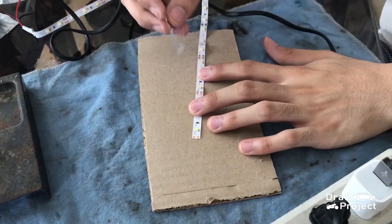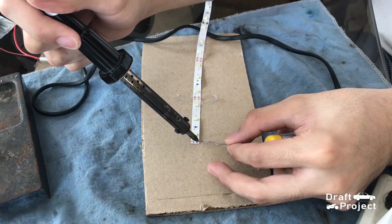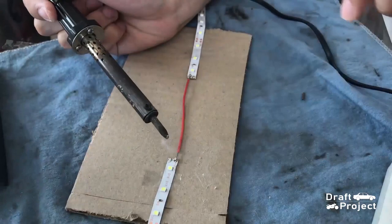The wires are routed in this section. Heat up your soldering rod and solder it. To make life easier, put a cardboard and tape the strip light — it will act as a holder so you can solder easily. Just solder a small amount of lead onto the mounting point. Do the same thing on your wires and connect them. Add some lead if necessary.